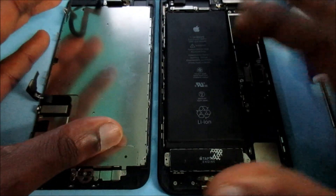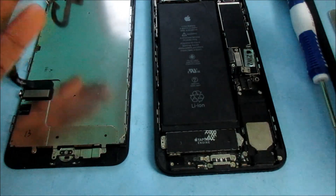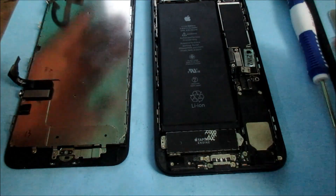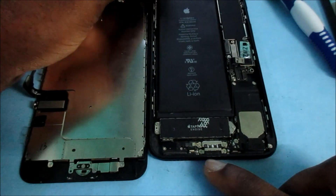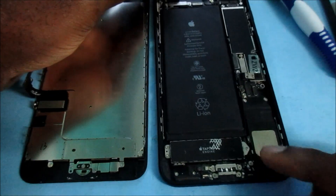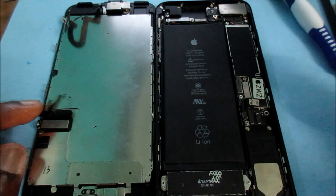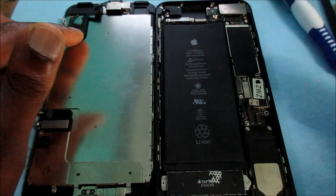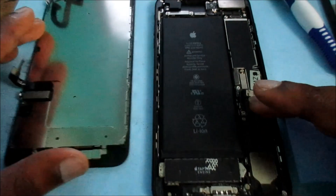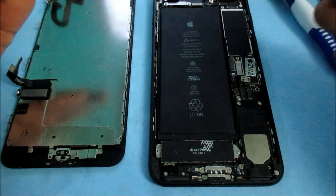You can do this as well — you can look for a tutorial on how to do so. You will have to remove the two screws at the port, then take off the screen, remove the ribbons — the video and the digitizer — and also the front camera. You can also remove your battery as well.